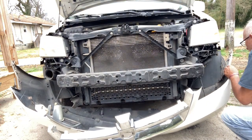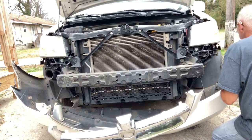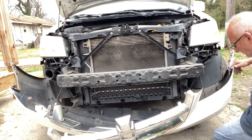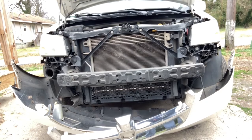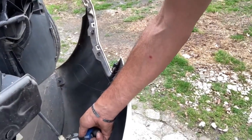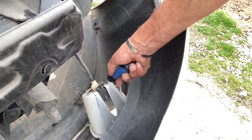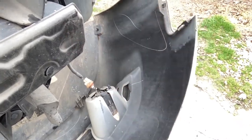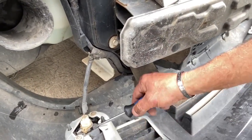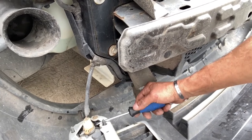This van is equipped with driving lights — some of them don't have them. If you do, they're really simple to remove; if you don't, just skip this step. Again, this is all plastic under here and with the heat you have to be really careful. There are little clips that hold the socket into the housing. When you go to lift over the tab of the light you may chance snapping that plastic clip — it is common. Luckily ours didn't. There are two clips on each side; release one and the light will pop right out of the housing.